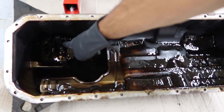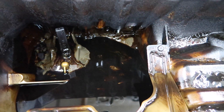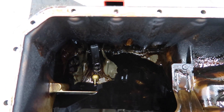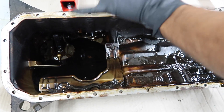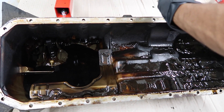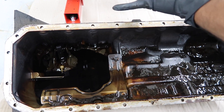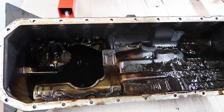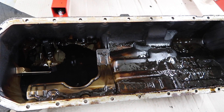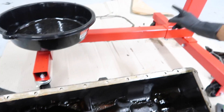Here's the oil level sensor that tells the oil level. If that is bad, what you'll get is a warning light that comes on your dash — the yellow oil light. What it does is it'll flash for like 30 seconds, it'll be on, and it'll just cut off every time you turn the car on, and that means your level sensor is bad. If you have an oil light that comes on and stays on for 15 seconds and then comes back on when you turn the car off, that means you're low on oil. If the oil light comes on while the car is on and it's yellow, that means you're a quart low. There's a more detailed DIY on the forums that'll tell you all the intervals to diagnose the sensor.